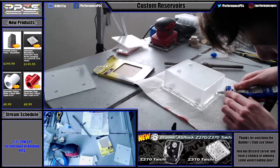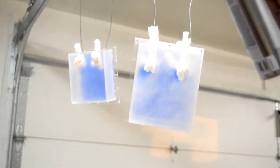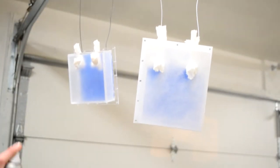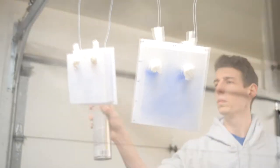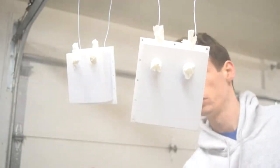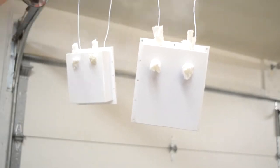If you have issues with leaks then you probably need a little more glue. Now that your reservoir is completely assembled and sanded, it's time to clean it up with some paint. I typically just tape off the front section where you should be able to see the coolant through, then paint up the rest so it hides all the lines from gluing and sanding. For the paint I used Astrolium professional grade automotive paint — it's a little more expensive but I'm not an expert at painting. Whatever paint you use, just put on light even coats. I put three or four total on these reservoirs, usually 15 minutes to half an hour to dry between coats. Just use regular spray paint tactics and away you go.